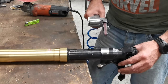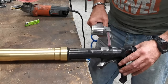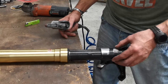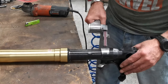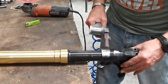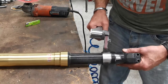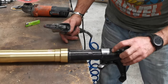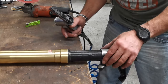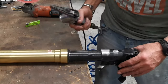But what I've found is if you start off on the lug and just keep moving it left and right, and as you're doing it, just rotate the part, then you're kind of putting a circumference in it anyway. But once you start getting down to the depth that you want to be, you obviously got to blend it all in. So what I tend to do is start off doing a narrow strip, then start rocking it. And every time I rock it, I go a little bit further, past where I ground it on the last pass. And then when I get right out to the edges, it's real light passes. Again, the same pressure that I've been using throughout, but you leave like this band where there's a tiny bit of paint, and it kind of blends up to full thickness. You end up with a really nice curve on it, but it's all blended and it keeps its shape rather than ending up with a 50p for a fork.